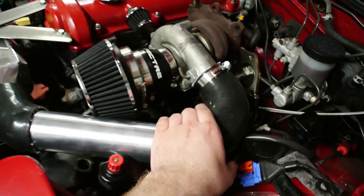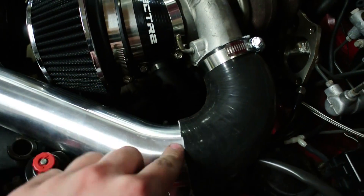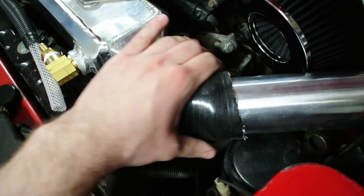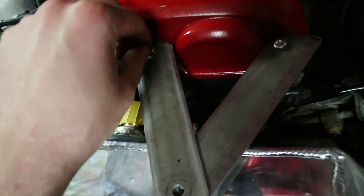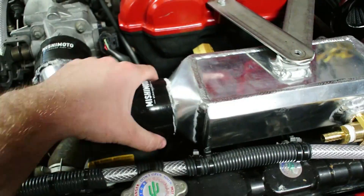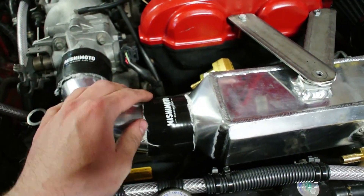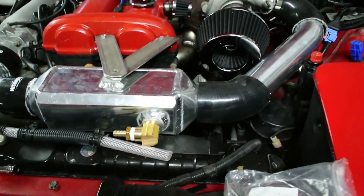We got a 2-to-3-inch silicone 90, had to cut it a little bit. It was straight with the 90 at the end — I had to cut the 90 off, and once I cut it off it was able to fit in here. We had another 90-degree elbow that ended up being more of a 45-degree elbow. We got the water-to-air intercooler in, made some brackets — just took some thick steel, bolted it to the valve cover, and then ground it down so it'll clear. On this end, I took the other 90 I had, cut it down, ground it flat, then put two couplers on. I still have to bead all these pipes, but the intercooler piping is pretty much all set and ready to go. It just barely fits.